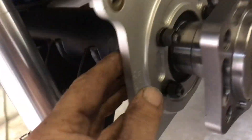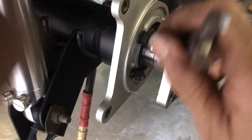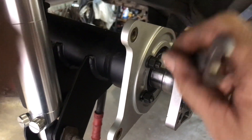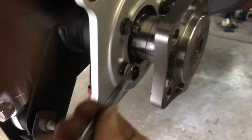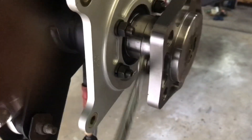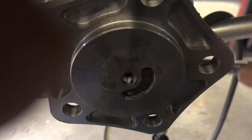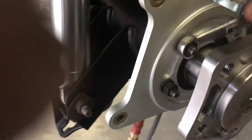Back to getting this thing back together. I clearanced this one also, put the T-bolts in it, had to clean out the powder coating on a couple of these holes. These T-bolts go in here and lock up against the back of the housing — tighten this up, now the bracket for the brakes is on. The bearings get pressed on — the bracket has to go on the axle, then the bearing, and then it's got a locking collar, a pressed-on locking collar. They sent another one with the new axle, so all this has to be pressed on while it's apart.